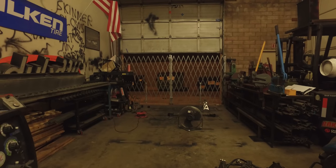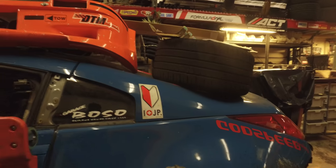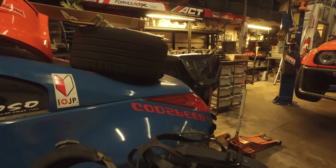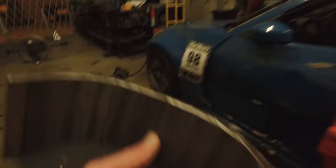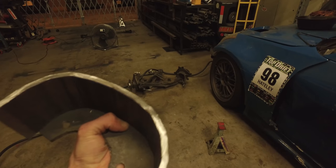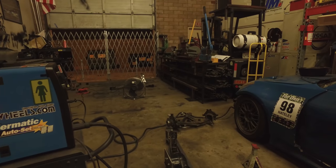Those will go in next and then I will finish welding on this jig. Throw the other subframe in the jig with the solid mounts and we will weld up the quick change mount, which consists of basically cutting off the stock diff mount and then welding a couple of plates like this. I already bent those up and got my holes drilled, so those will go right there and bolt up. I'll weld them up and see if it fits.